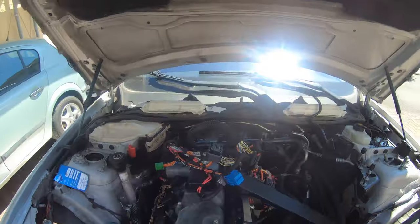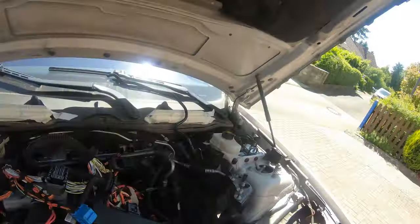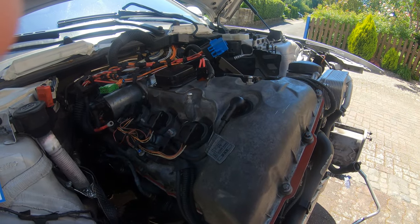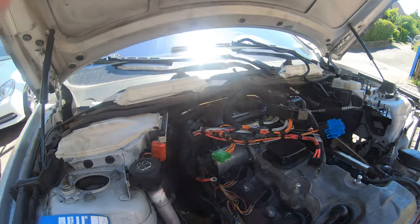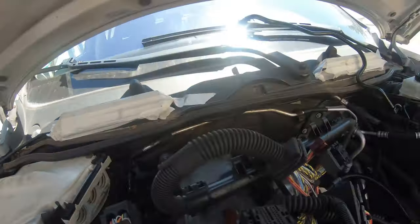It was very challenging — the E60 engines have a different motor mount, but luckily I had my old engine so we were able to put that in. Word of advice: have two people putting in the engine — one from the front, one person underneath moving stuff out of the way. We didn't realize we were kind of hitting on some stuff underneath the car, and I don't think we broke anything.